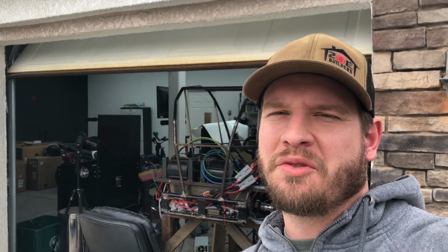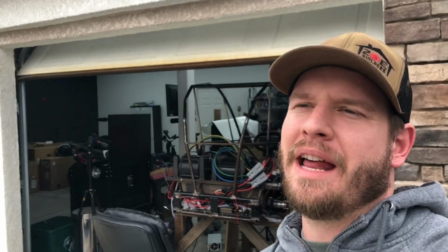So the last check-in was from last night at about 1 a.m. and I'm standing a bit back from the controllers now because I got some beeps going on. I ended up realizing my main problem was I had the orange key line connected to 12 volt, which is through my relay. It needs to go through a switched 96 volt. So I got to redo some of the wiring when I do the tear down. For now, I've got it running through a separate switch.